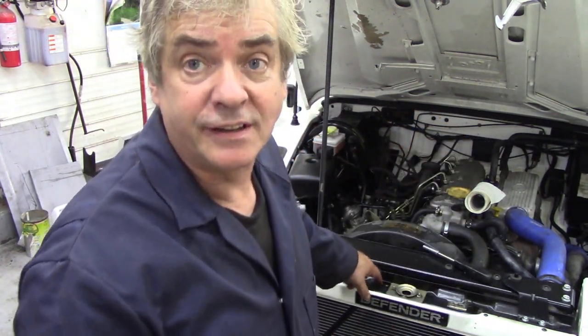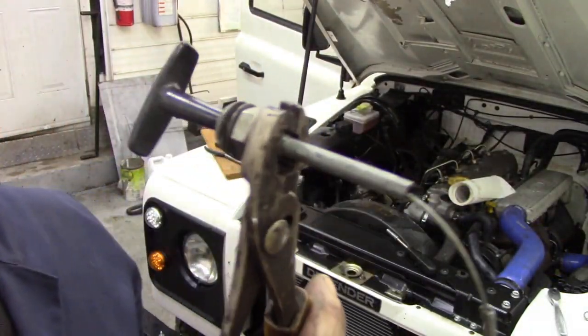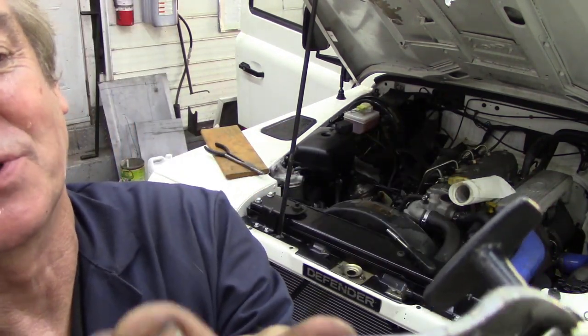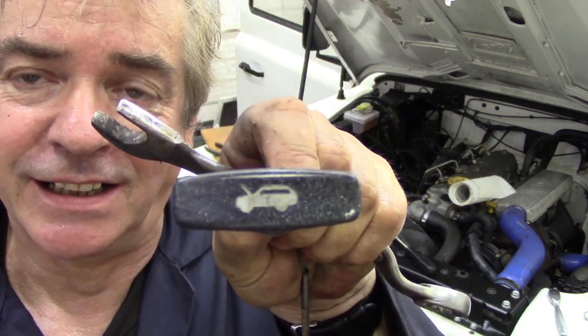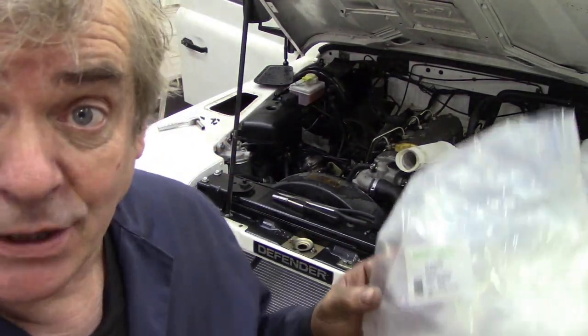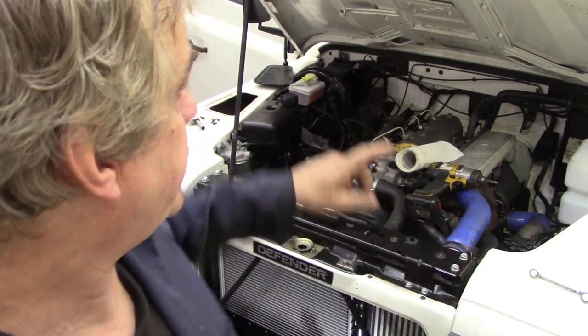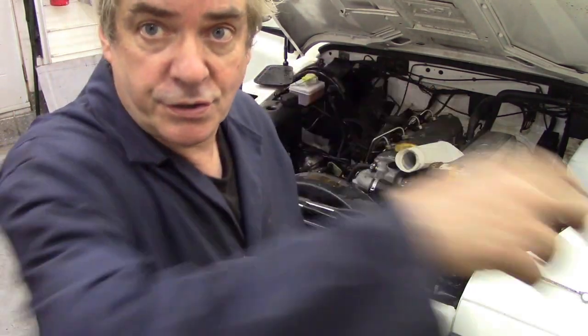The nice thing about these new cables is they're soldered at the end, so when you put it through the little connector it's going to be a dream - or is it a nightmare? Let's see. What I do is I turn the ferrule but lock it with a spanner - I cut one down so it jumps in, because you can't actually turn the spanner. You hold the nut and turn this until it locks up. Don't forget the little finer details - put the little cap that way up, not the other way. The cable I used was actually a longer one, ALR 9555, for a left-hand drive NAS spec 90 or 110.